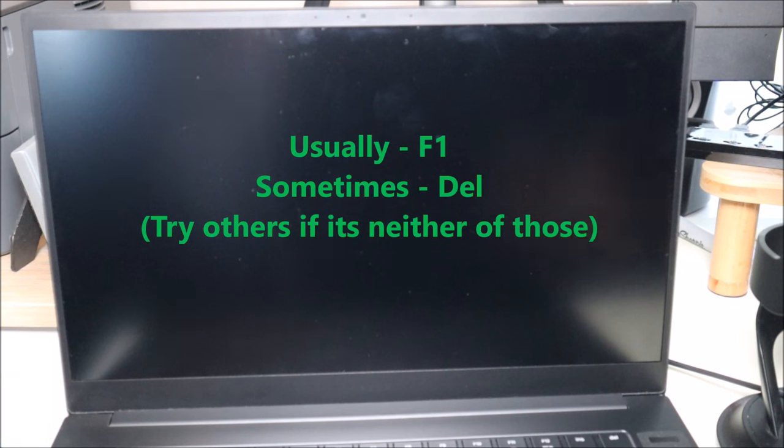The first steps I'm going to show you is how to troubleshoot some BIOS issues — you don't have to open the computer up for that. To get into BIOS on a Razer laptop it's usually your F1 key after you hit your power button. Sometimes it can be your Delete key. If neither of those work, try the other function keys because some models do use different keys, but most of you like me are going to have F1.